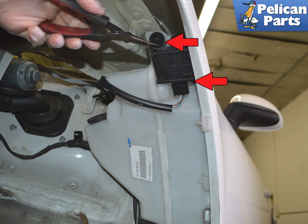On the front driver's side, the antenna is located on the windshield washer reservoir behind the removed wheel well liner. The antenna is held in place by two pins and an electrical connector. The pins should be easy to pull out with a set of pliers. Both the pins and electrical connector can be removed without removing the reservoir from its housing in the chassis. If this is the first time removing the antenna, you may have difficulty pulling the pins out and may need to remove the reservoir to get access to the back of the pins.